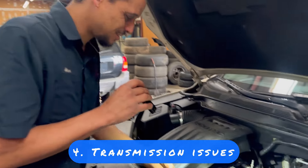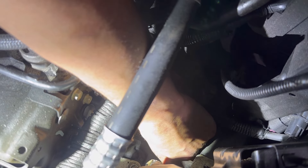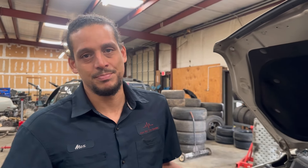Number four is going to be this transmission right here. It's kind of buried down in there — they don't have a dipstick, just a little fill plug right here. They do give you something to fill the transmission up with, but not to check the fluid. The reason I know they fail is lack of maintenance. You're supposed to change out your transmission fluid, depending on how you drive, every 30 to 60,000 miles — I normally say every 30, better safe than sorry. People who drive more aggressively: 30. People who drive very slow and keep the transmission working less, you can push it to 60.